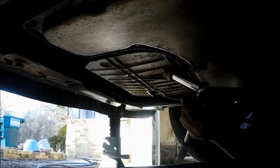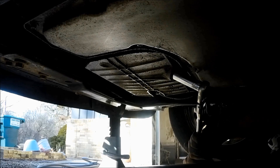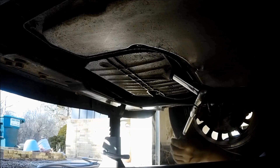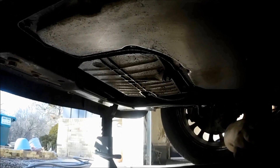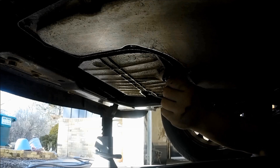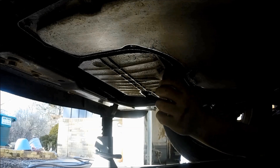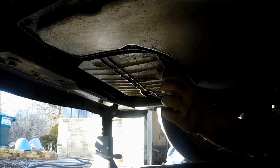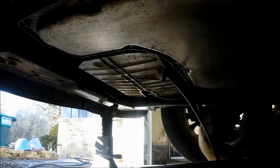This current car has a 15 millimeter drain plug. Just loosen that up — as you can see, this is the engine oil pan. Never lift the car from the oil pan; lift from the appropriate subframe. Get the plug out by hand and the oil will drain.